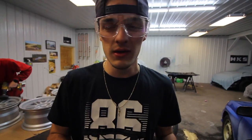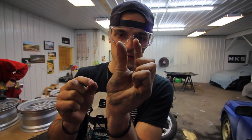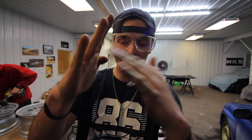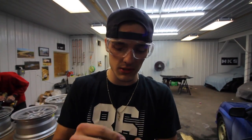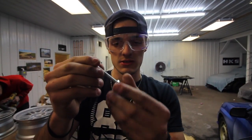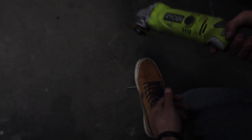We've been having issues with the size of the bolt going into the wing. The metal in the car is about this thick and the original bolt they gave us is tiny — there's no way I'm putting that tiny bolt through where it could drop down into the frame of the car and be lost. So we're going to mod our own solution: take a longer bolt with the same thread pitch, chop the end off, push it up into the spoiler, and then put a nut on the other side to come up and lock it against the body of the car.